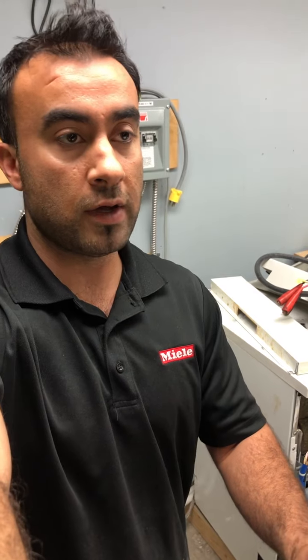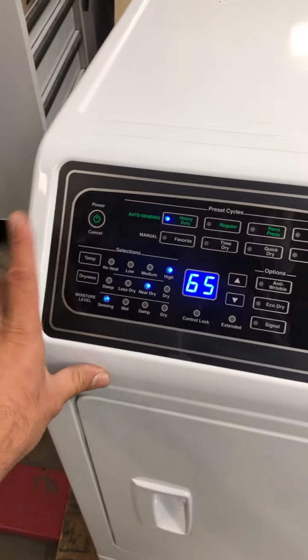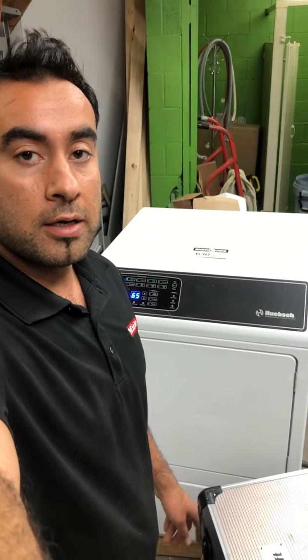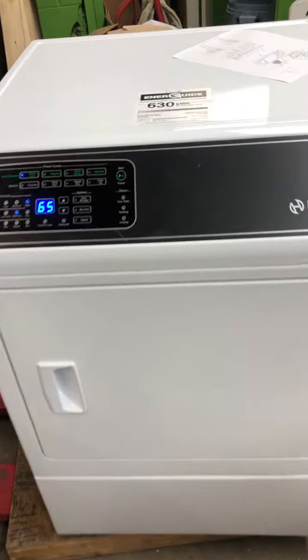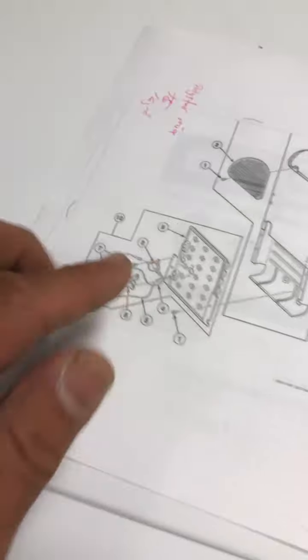So far I'm getting 142°F. I did the exact same test a couple of minutes ago and was getting a maximum of 100 to 150 degrees, which is not too bad — it's okay. So there's nothing wrong with this dryer, and I'll have to talk to the customer about changing their ventilation hose because I have a feeling they're using a very long vent hose.